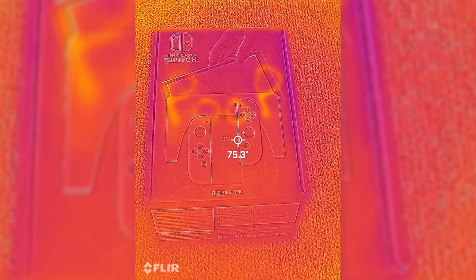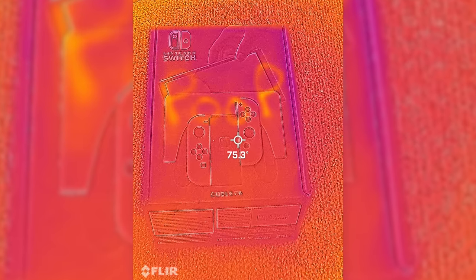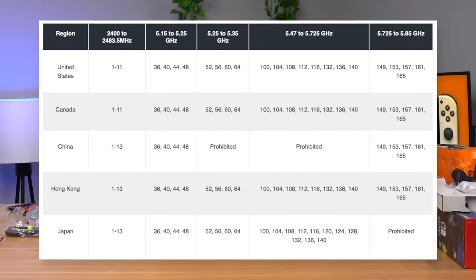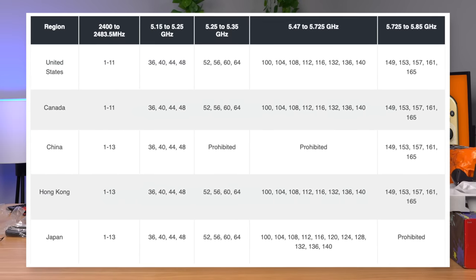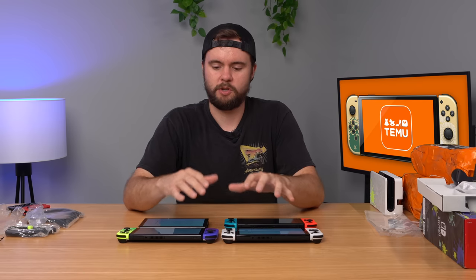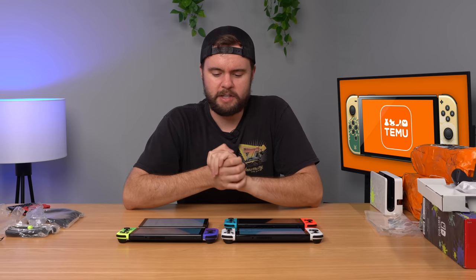I just turned on my thermal camera and got what I guess is a secret message from Temu — not sure what to do about that. I made a couple of interesting discoveries about the whole internet situation. The Wi-Fi channels supported in Japan and Hong Kong are slightly different than the 5 gigahertz Wi-Fi channels in North America, so you're literally just locked out on these consoles — you cannot use those channels. That's definitely an issue if you're buying these to use in North America, unless you actually go into your router and change your Wi-Fi channels, which most people don't want to do.